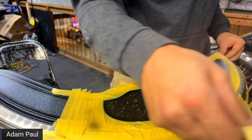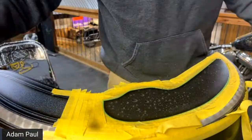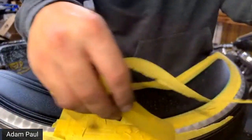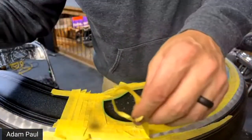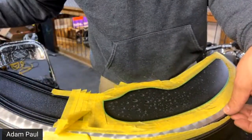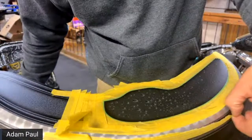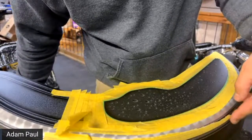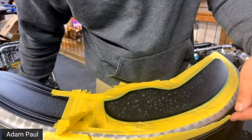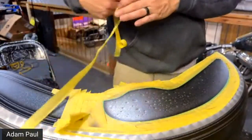Then someone said, if I want to paint my 18SG, can I just scuff the clear? It's stock vivid black with no dents. Yes, that's how you would do it. You would scuff down the clear, probably with 600 grit. If you have any rock chips or anything like that, just blend those out with some 600 grit, red Scotch-Brite. And yeah, you're ready to go.